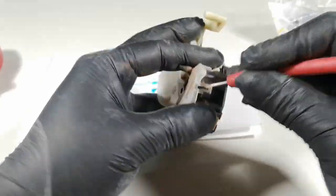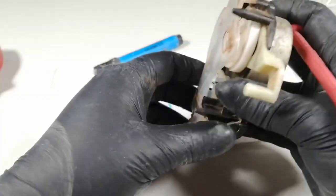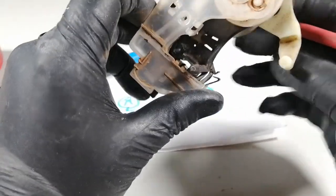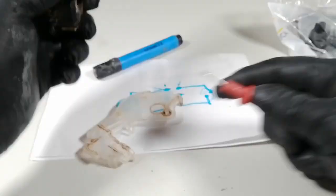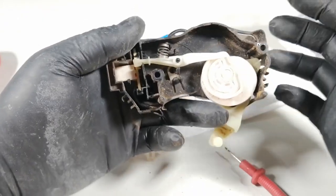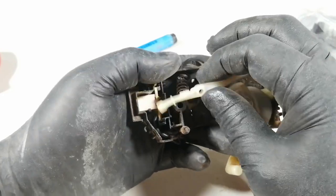This is another one. This type of actuators, when they fail, it thunders the clutch, well then the pulley with the drum, but there are times that many change it when it is good. It was only to clean and lubricate the slider and the drum and the pulley, all that system. It has to be lubricated and everything, and with that it looks pretty good without the need to change the actuator. In this case it was already damaged, so I know it is damaged because I changed it, and now I am going to check why or where they have the fault. Remove this part and save.